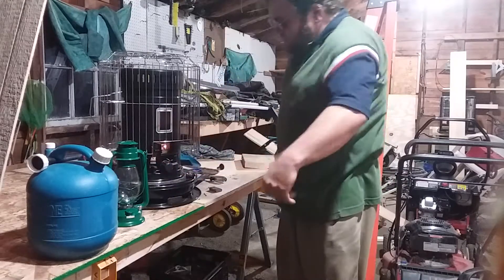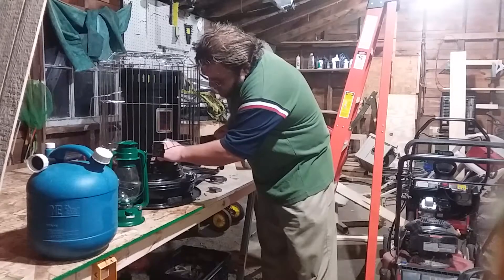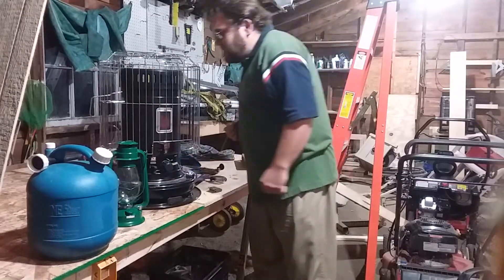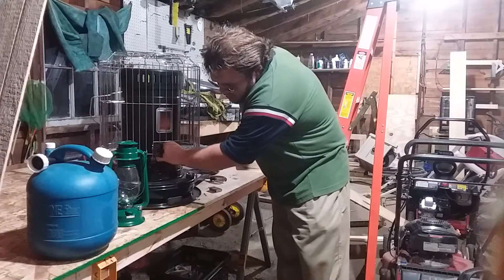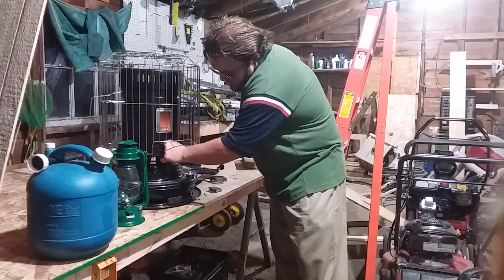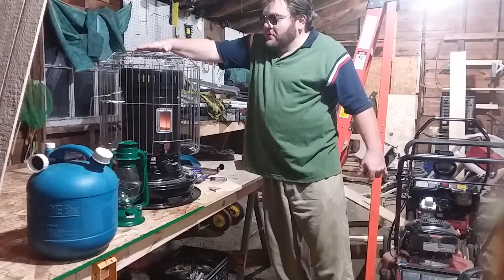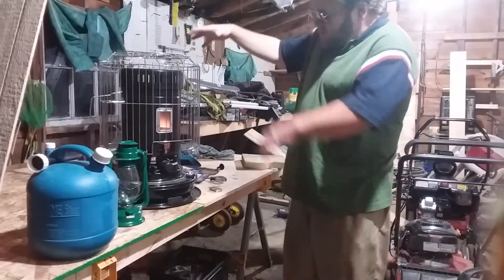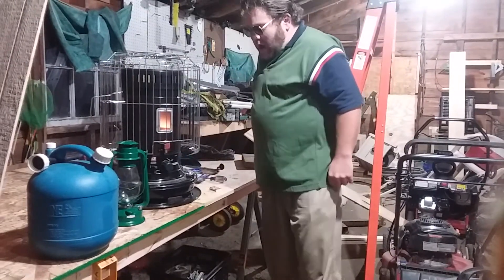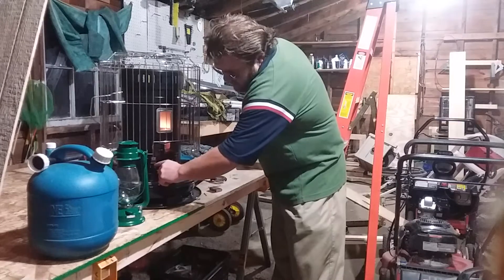...lift up inside there and turn it on. Then shake this to help get the wick all the way around, because the wick will slowly start to spin around like a big circle and you'll have heat. As you spin it around, this little cone will get warm and start to glow orange — that means you're producing heat. Over time the cone gets oranger and oranger, producing more and more heat. When you're done, hit where it says manual shut-off.